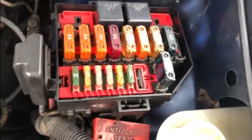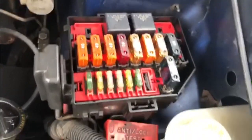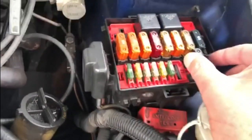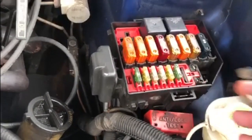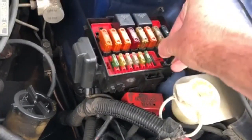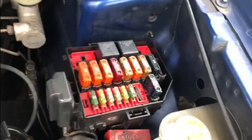So that would be this row here — and that one there. John was right that it's a fuse — it's a 60-amp fuse, so it could well be for that. It is definitely for the ABS, but as you can see it's a 60-amp fuse and it's perfectly sound — there's nothing wrong with it. So unfortunately that isn't the relay, and the search continues.